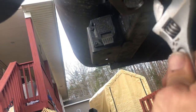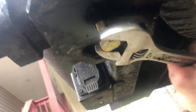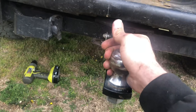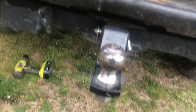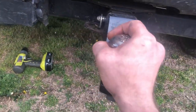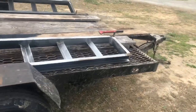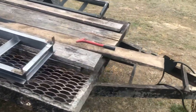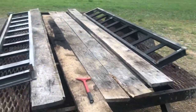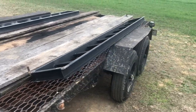If I could go back I might have chosen a shorter bolt, or I could just shorten this one since there's no shoulder on it. But look at that — that fixed that wagon right there. The only thing left to move around is the ball, and the ball's pretty tight. So that should fix the rattle. Please subscribe for more, and if you guys have any suggestions, criticisms, or video requests, leave them down in the comments and I'll do my best to make that video or answer any question I can. Thank you so much.